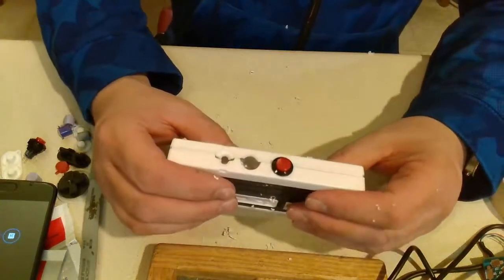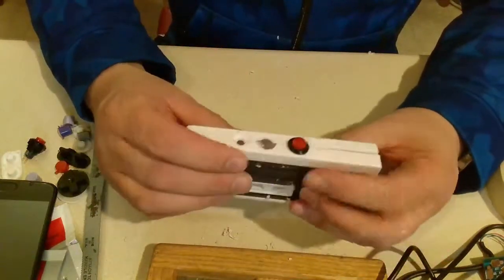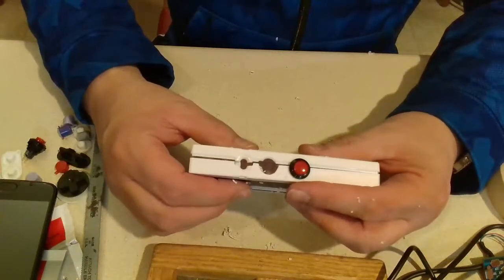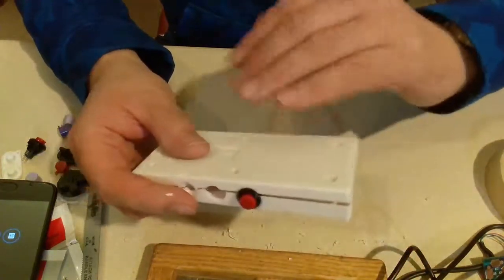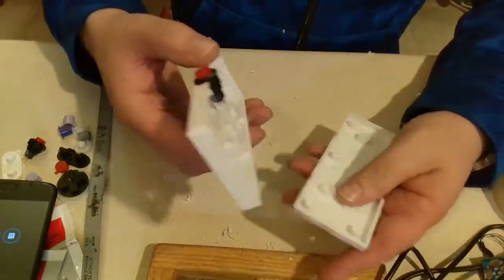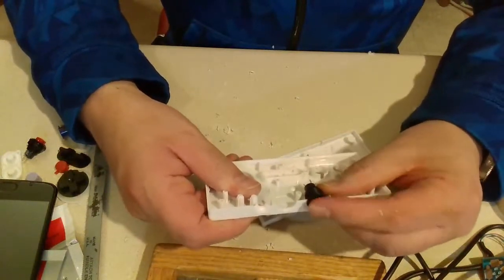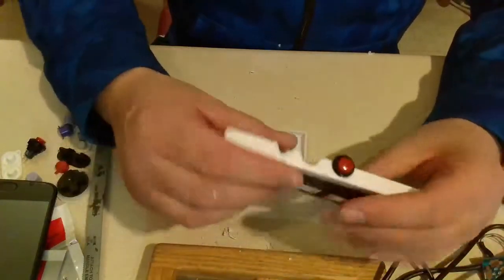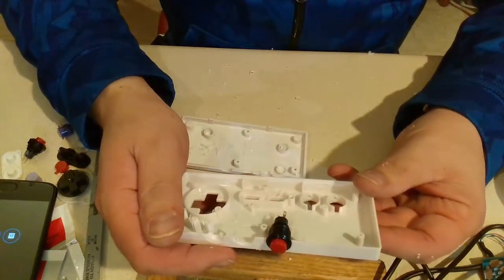If you're going to buy a step-down bit, go to Harbor Freight. They have a 2-pack, stubby and long, for under $10 if I remember correctly. It's been years, that's how long they last. When I used to work on cars, I would get the really high-end, expensive ones, but I was going through such cheap metal, and I needed one in a pinch real quick, so I stopped at Harbor Freight. The bit you just saw me drilling with is the exact same one I bought back then, even through thin metal, which is car metal. Now, if you're going through pretty thick gauge, it's a different story. But they're nice for going through plastic, so you get a round hole, which I'm not proving here.